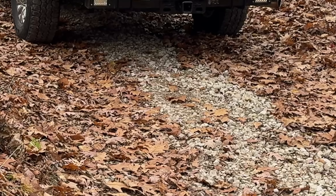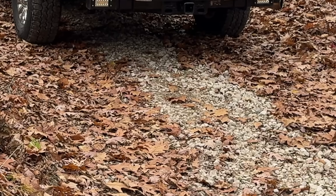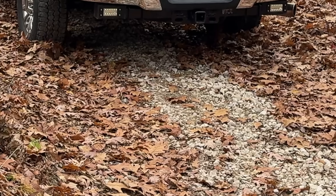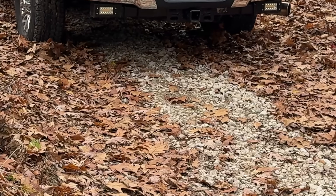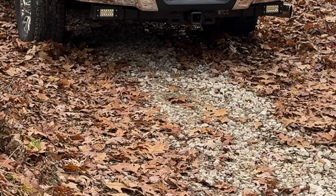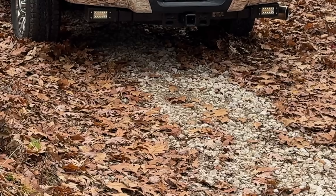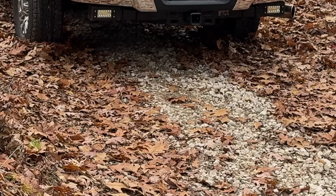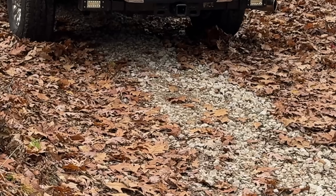At this point I stopped about halfway up the hill and put the truck back in two-wheel drive to show a close-up of what's going on with these tires. As I apply power, you'll see the tires start to spin — one tire spins, then the other starts to spin. That's traction control doing its job, applying brake pressure to the side that's spinning to try to gain traction. Then you'll notice both tires spinning at the same time because I've locked the differential — the truck also slides sideways because both tires are spinning simultaneously. And then our final attempt is four-wheel drive and the truck creeps up the hill.